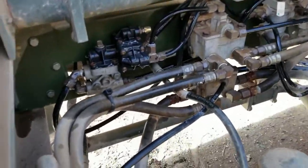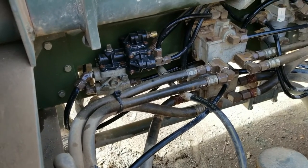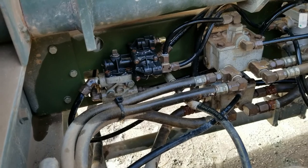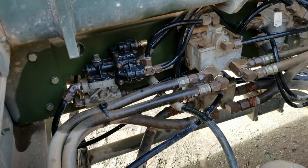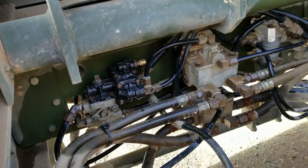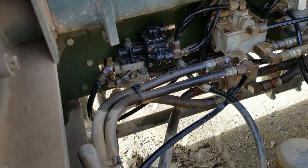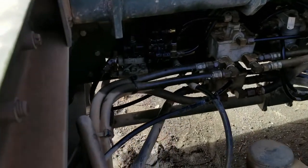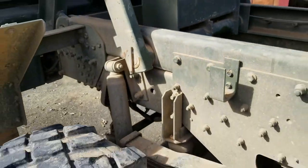All right, so I sprayed everything down with soapy water and found some of the hoses could be tightened a little bit more. There's still tiny, tiny little leaks around some of the hoses and that plug there on top of the plastic cover on the valve seems to leak a tiny bit, but it's very, very little, nothing like before. Why don't you go ahead and hit the brakes? So you can barely hear anything, and I get a little tiny bit of bubbling out of that. But other than that, it's really good. And so I think that's going to be more than adequate. That definitely solved the problem. It was leaking like crazy before. So I guess that's it.